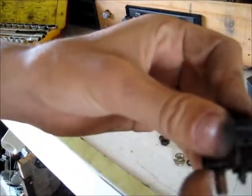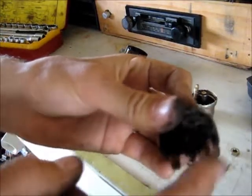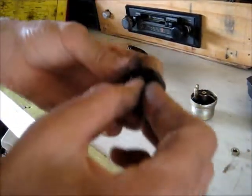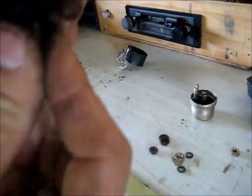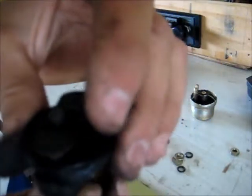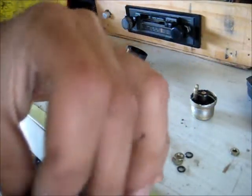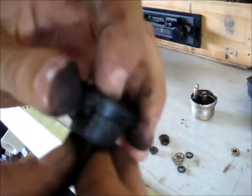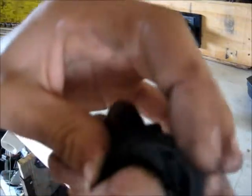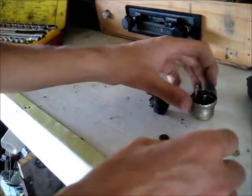Make sure these bolts on here are tight when you're first putting this on. It's got the bolt there and you've got two washers, and there's little seal O-rings here, so make sure these are damn tight before you put the other connections on. You can see how much carbon and stuff has built up in there, and a bit of pitting on there, so I could probably fix this, get this thing cleaned up and it'll work again. A very dirty connection in there - that's why it wasn't clicking intermittently.